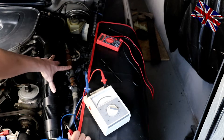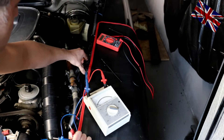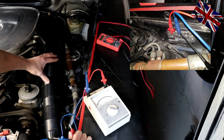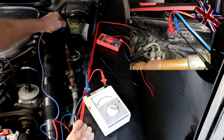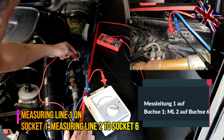We are back. Welcome to my engine bay. This one here is being called X92 — test socket box, onboard diagnostic device. Welcome to the 80s. To open it, just pop the plastic cover. Here you see the 8 sockets. To test this, we merely need an analog multimeter with 3 connection wires with banana plug tips. Let us start.